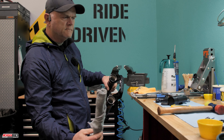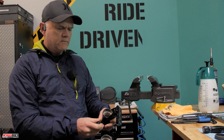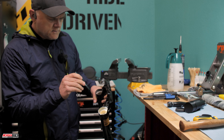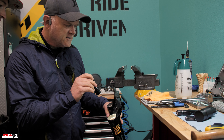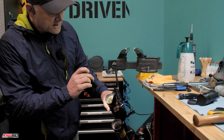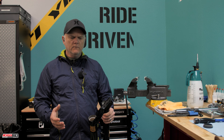Following the dowel clean, take a flashlight — or your phone light, which most people use — and check the inside. Check your bushings, make sure everything is good to go. They are — so now we've inspected the lowers, the bushings are good, and everything's nice and clean.